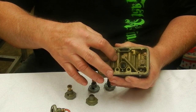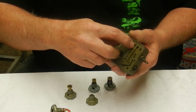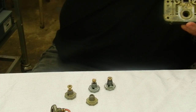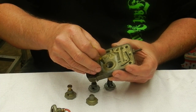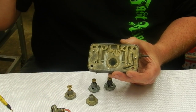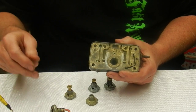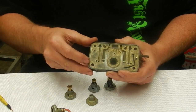The fuel feeds right into the main well — there's the jet hole — it feeds up the main well and comes out the back here to the booster. These little holes right here are the restrictions; that's what determines the flow, not the power valve itself. The power valve just has to supply enough flow for those restrictions.